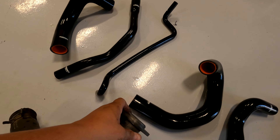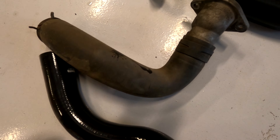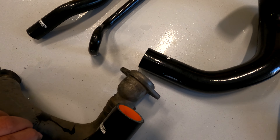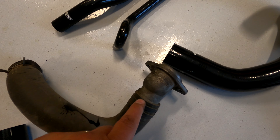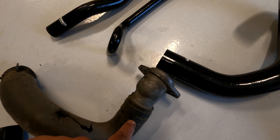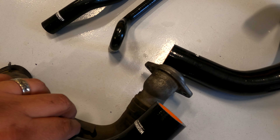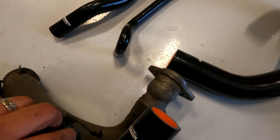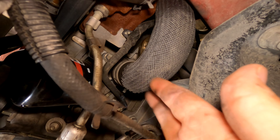So what we're gonna do now - let's find out which hose this is, it's probably this one. I'm going to take this clamp off, pull this hose off, and orientate it pretty much in the same direction. Then we're gonna use worm drive clamps instead of the old style clamps. I'm gonna put it on loose enough where it's tight enough not to fall off but also loose enough to move it around a little bit during installation.